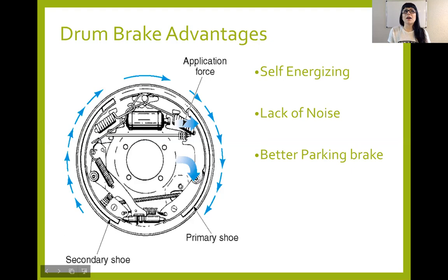Making my rear disc parking brake meant that my parking brake is now a caliper design. And the first thing I noticed is I had to put in so much more effort on my part in the center handbrake than I normally would with my drum brakes in the rear. They definitely are not as efficient at their job as a parking brake.